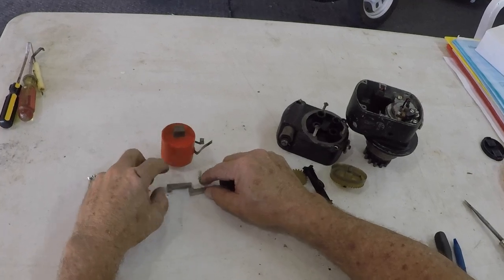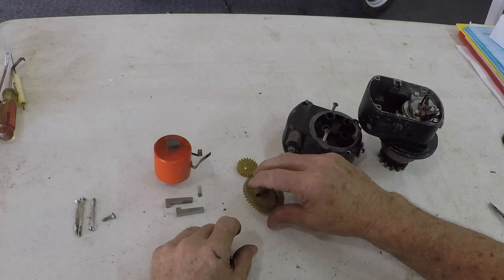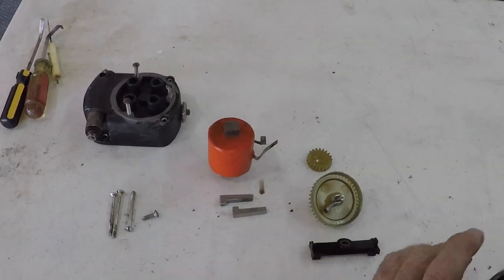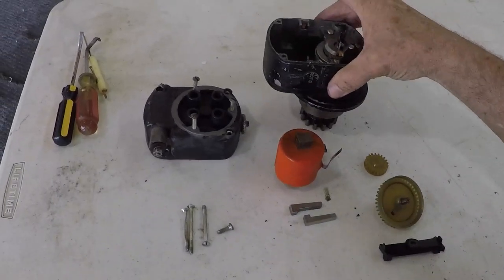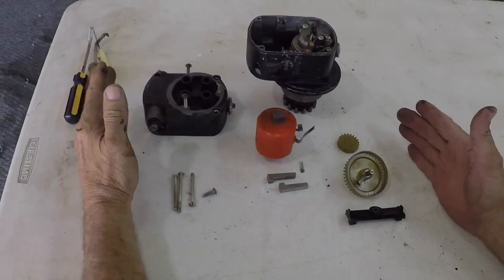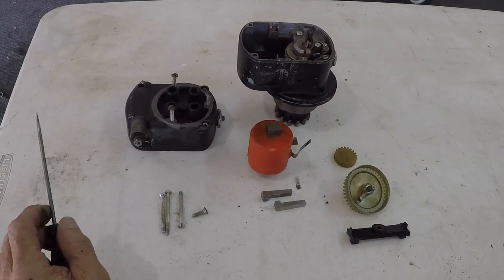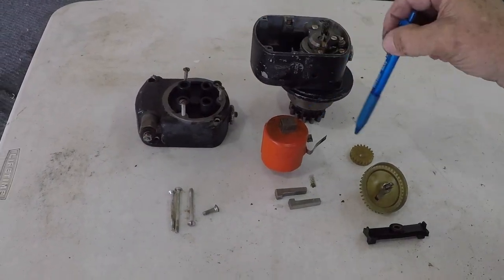Get all these parts laid out right — two sets of gears, the gear support, the top and the bottom. It's okay to spin it now because I won't get shocked — the coil's out. So this is what makes up your mag. Even in older mags like this one, we have the same number of pieces, different part numbers and maybe a different style. The case is definitely different.